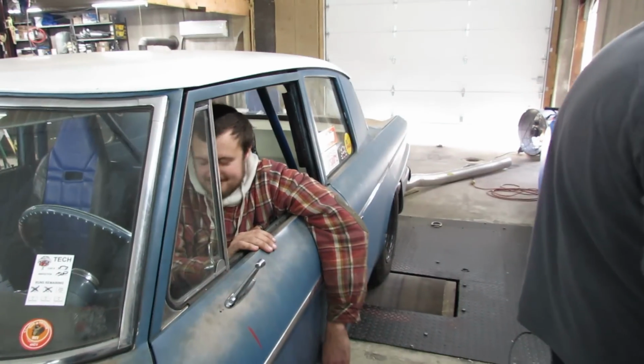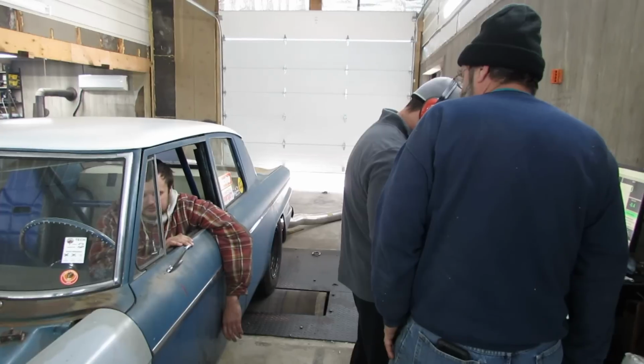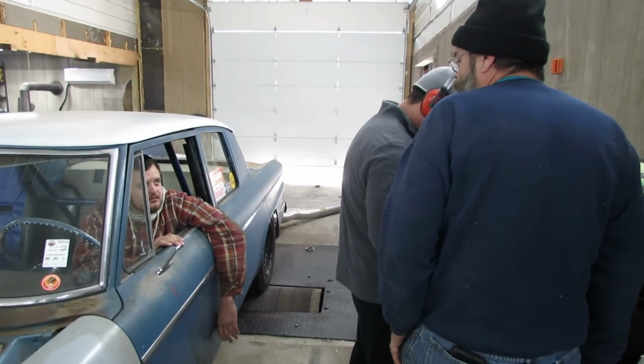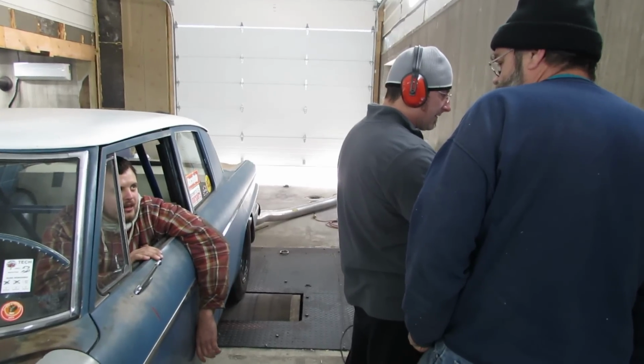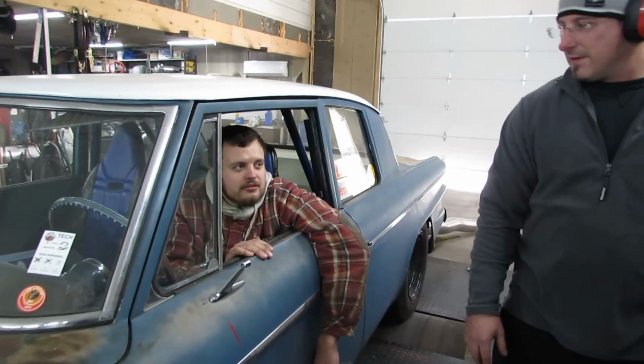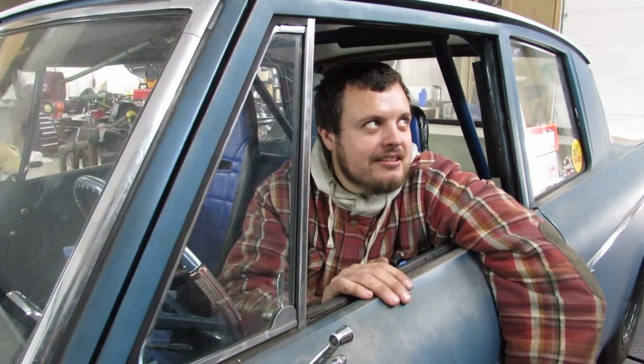That 2 degrees was 50 horsepower at some of the RPMs. Your peak number was the same, but it was this to this. Okay. I'm not gonna put any more timing in it. So, more boost. But back pressure ratio is about the same. Back pressure looking good, man. About 1.5, 1.6. They say these turbos are 600 crank horsepower, so based on what their rating is, we should be close. Yeah, probably.